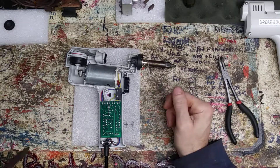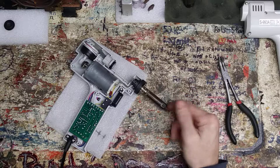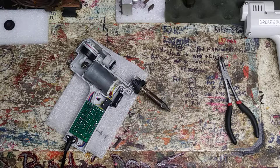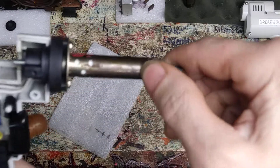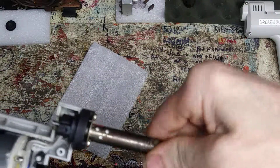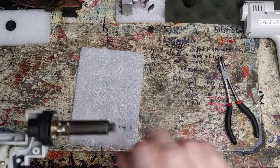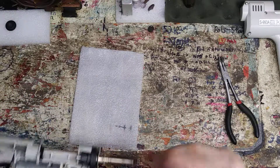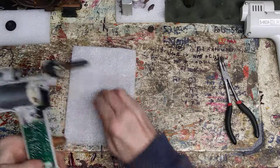I'm gonna pull the wires and pull the whole thing — probably actually take the tip off and strip the thing right out. I think what's going on here is they pinched it in. I'm unplugged so I don't get zapped. If you look right here you'll see a dimple right where my thumbnail is, and another dimple down in here. Take the tip off and nothing moves — the heater element doesn't come out. So I believe they're just punched in there to hold the whole unit together, so I'll probably drill them out. Looks like there are three of them — three is the magic number.